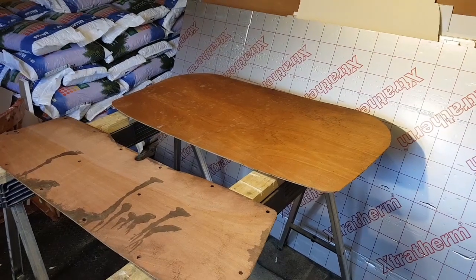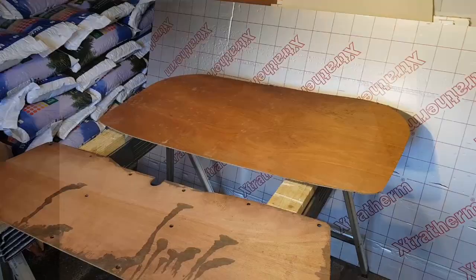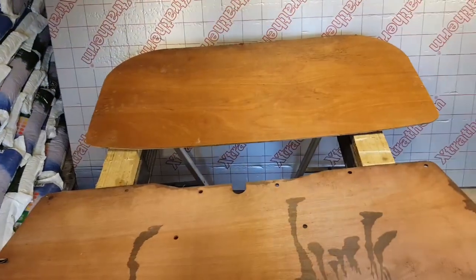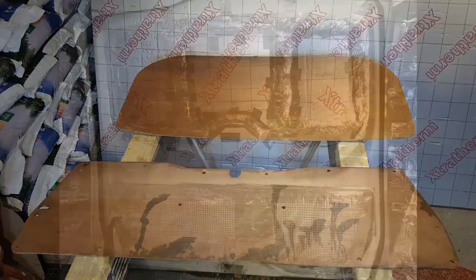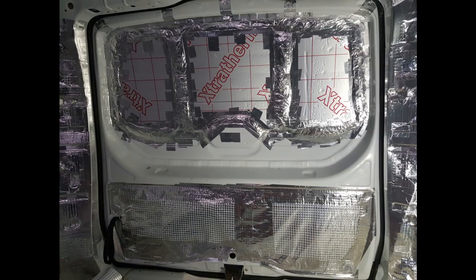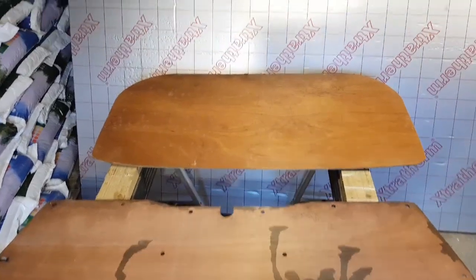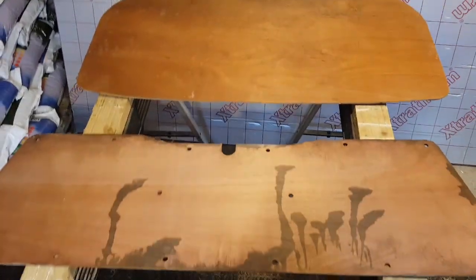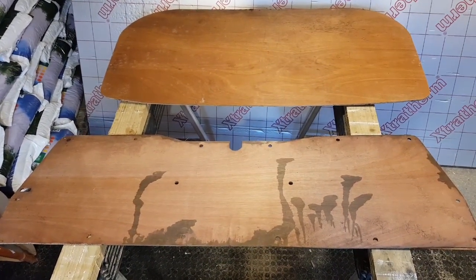As concerns the panels I did for the sliding doors, I've decided I'm not going to fit those on my own — it's much easier as a two person job. So I want to cut out the wallboard for the back door; that's the top and bottom original cards. The top one I'm going to be able to use as a template, but the bottom one I'll need to make a bit bigger.